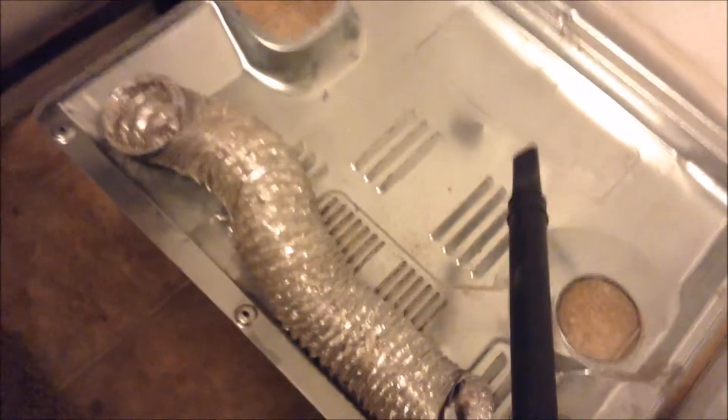I got my vacuum with this nozzle to get all the lint from every area. I took the back off — there was a lot of lint around the components in the back of the dryer. Next I'm going to take this off right here — this is the little lint trap chute. I'm going to unscrew those little screws and see what needs to be cleaned down here so all that can come off.